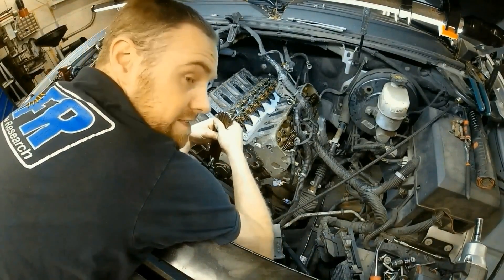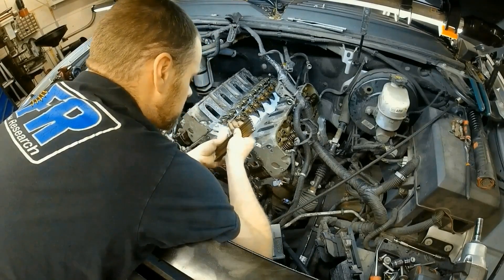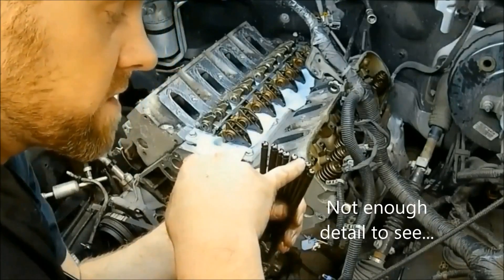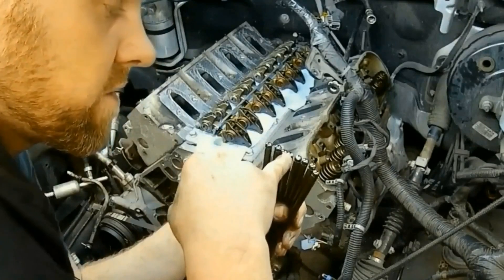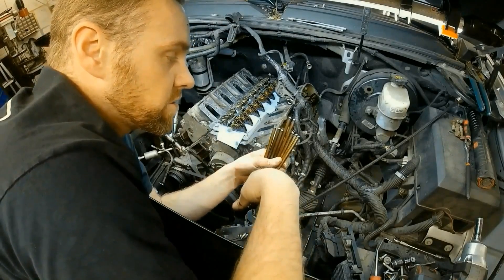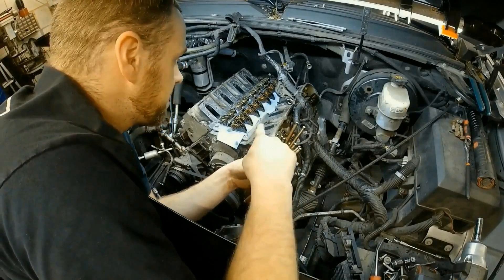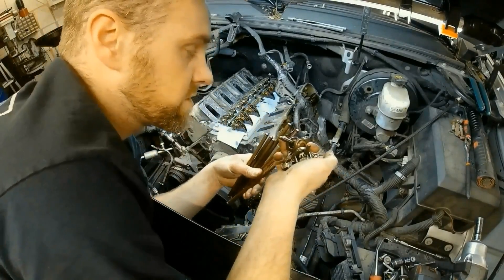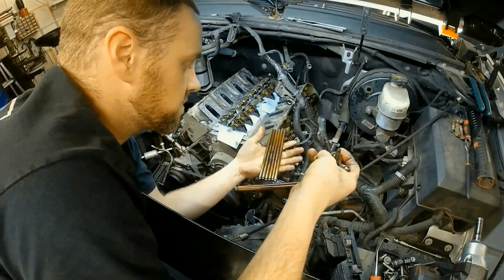And that's exactly why I kept them in that order — there are some that are worn out badly. We have these nice shiny ones, then this one and this one have a nasty groove or flat worn into them, and these three are in good shape. So two in the middle are junk and these ones are good. I have to replace these two and the correlating rockers with them — they've got a funky groove worn in to match. These others I'll reuse.